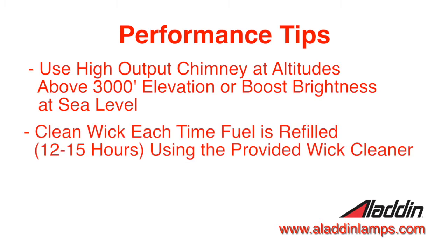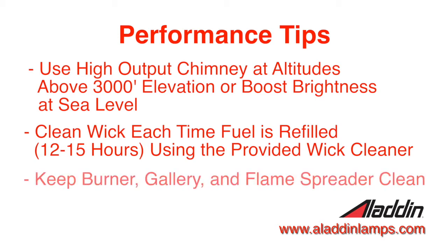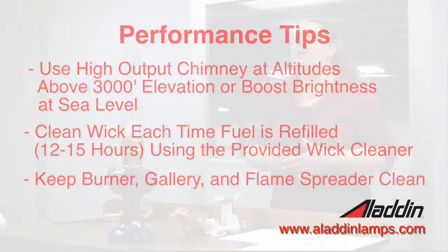Keeping a clean wick is really important, so remembering every time you fill it with fuel to clean the top of the wick, or anytime there's any stray threads or you're just not getting a good light out of it, it's good to go ahead and clean the wick again. And keeping all of the parts clean, so your burner, the flame spreader, anything with the little holes that can get clogged up with that carbon buildup is blocking the air travel through the burner, through the flame spreader. So keeping those clean is an important step as well.